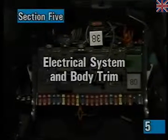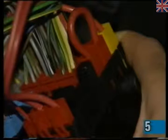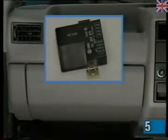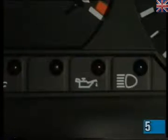The new transporter's electrical system follows the design of the Passat vehicles and is therefore fitted with the latest type of relay plate and wiring looms. Relays for wipers, fuel pump, indicators and starter X relief circuit can be found here, while the engine digifant control unit is situated under the bonnet. To remove a wiring multi-plug from this type of relay plate, you must first slide the locking bar to release the plug. Additional control units for electric windows and auxiliary heater etc. will be located above the glove box area. The new low oil pressure warning buzzer is located inside the instrument panel.